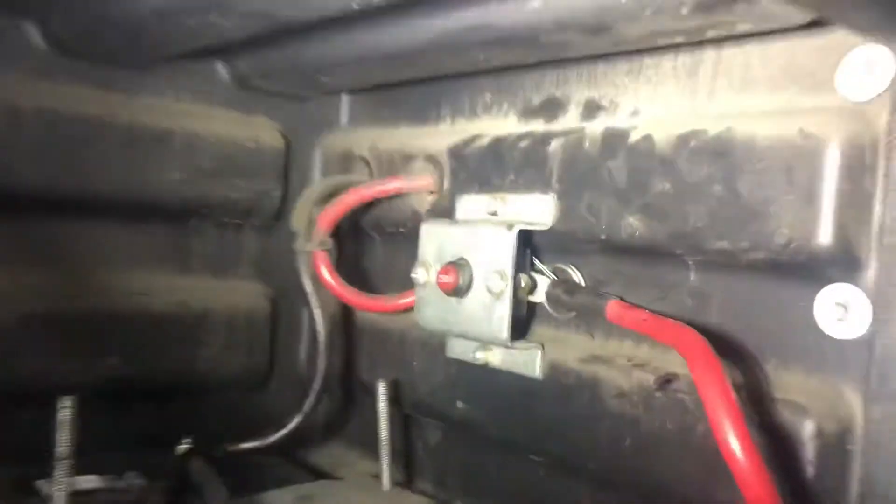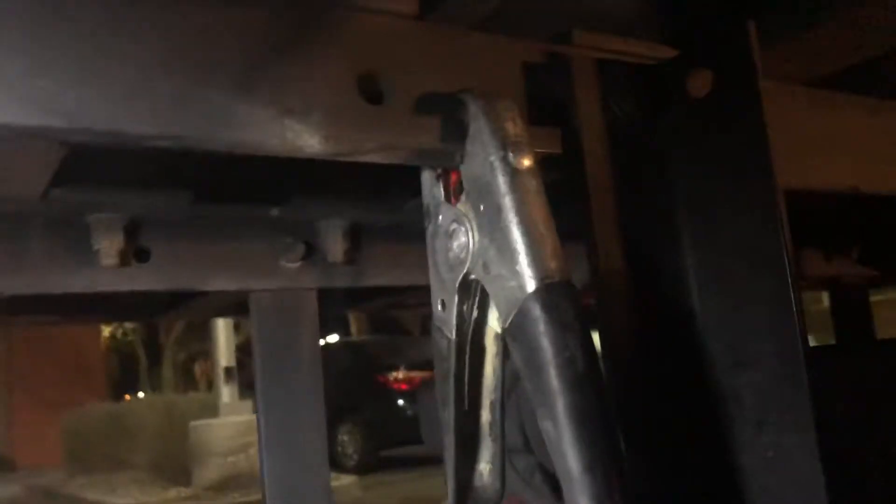I've got a dual battery setup right here. I've got power coming to both the batteries. Check your relay there — that's good. Check the relay on the box right here, make sure that's good. What I did is hook your ground up. I'm pretty much bypassing the panel, bypassing the little breaker in there, whatever that is, and running direct power to the motor itself.